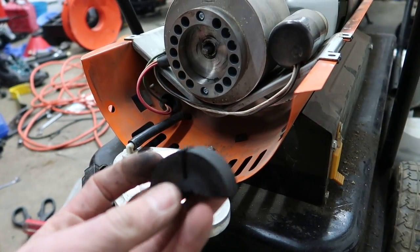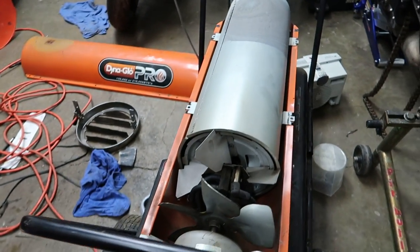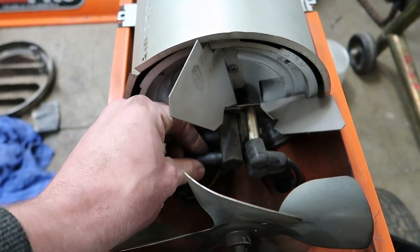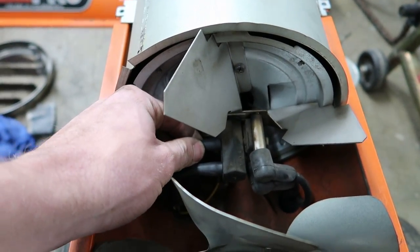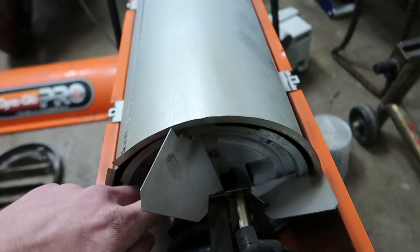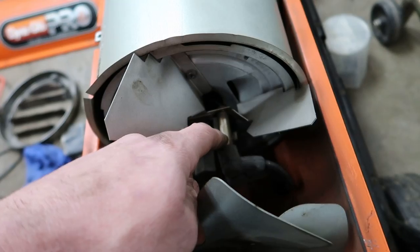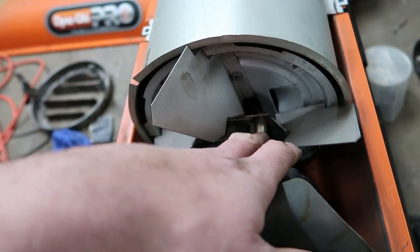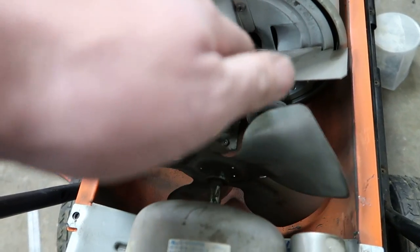Hope this video helped you guys. Please subscribe and thanks for watching. Also, I'll show you a couple other things too. This right here is the fuel line where it takes fuel in, and then this right here is where it blows air — and that's what that little fan that's broken does. It blows into there, and then this igniter lights up, similar to the deal you have on your grill that ignites the fuel. You can see that sparking when you turn it on, and then your motor should also be turning on a few seconds later, spinning this fan.